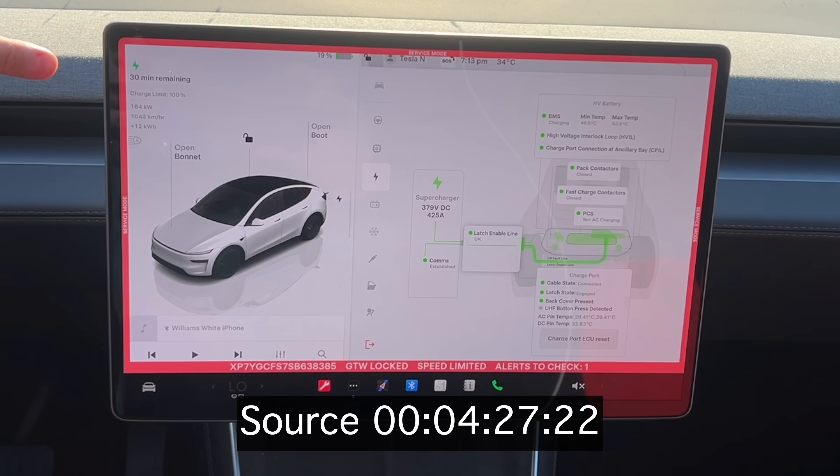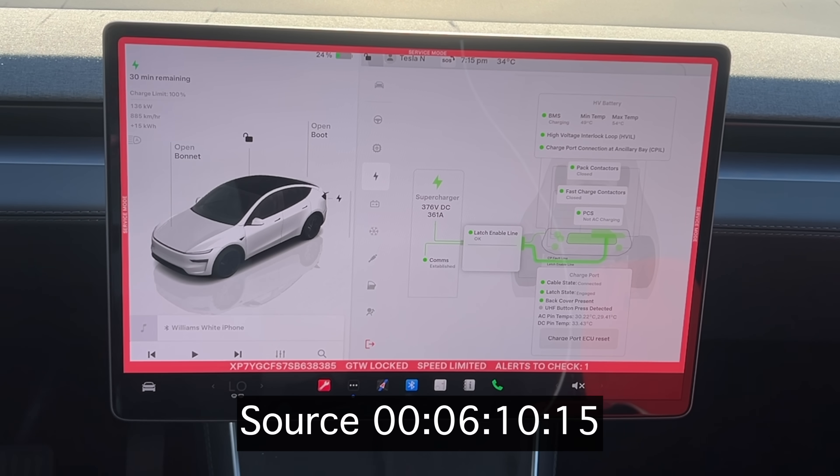This pack doesn't like 53 degrees Celsius in the battery pack. At 18% state of charge it starts dropping off — unfortunately it wants to go even lower: 140, 130, then around 120 kilowatts at 22%. Now something strange happens — the power is increasing, which is very unlike Teslas. Teslas usually peak early and never reach that peak again, but this one requests a little more power down the line. We're at 30% doing 130 kilowatts.